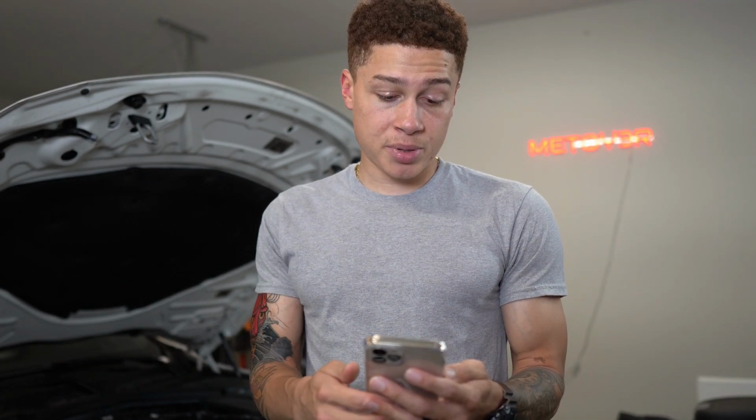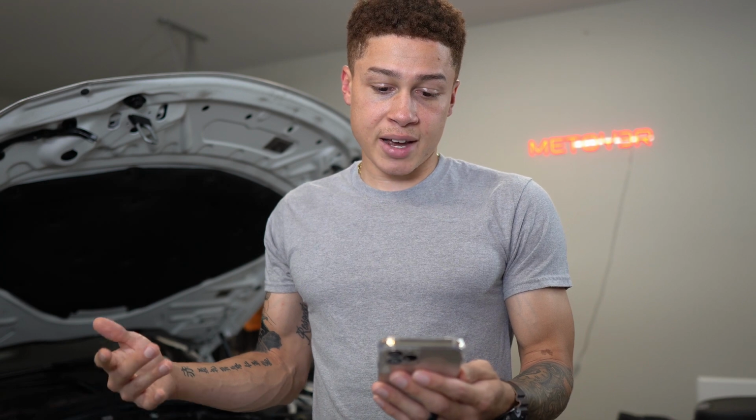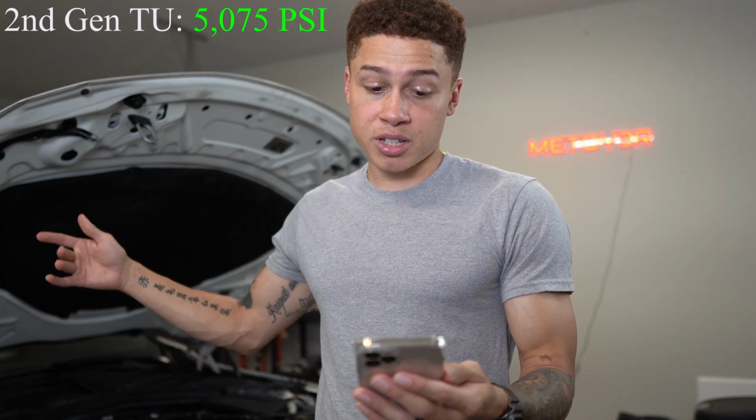second generation TU pump. So just so I can give you guys some numbers, I actually have a website. I'll leave a link in the description below if you want to look it up. It just has the differences between the B58 and the B58 TU, or the first generation and second generation. According to this website, the B58 TU pump flows at a 75% increased pressure. Maximum fuel pressure on the B58 TU is 5,075 psi as compared to the first generation fuel pump, which is 2,900 psi. So by switching from the first generation fuel pump to the second generation TU pump, I'll almost be doubling the output of the fuel pump, which is crazy.